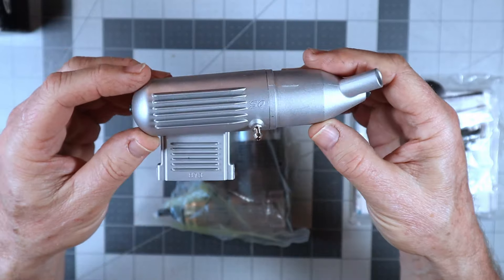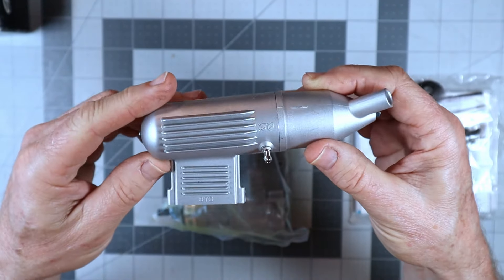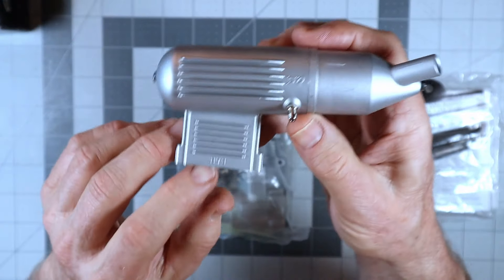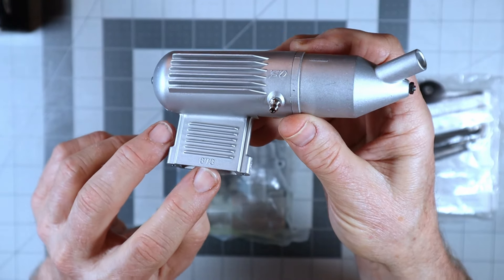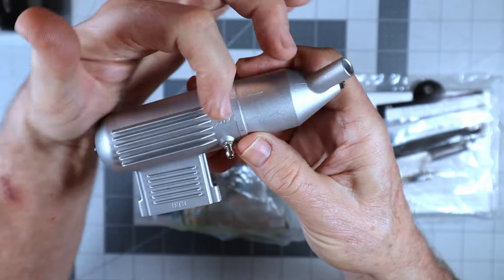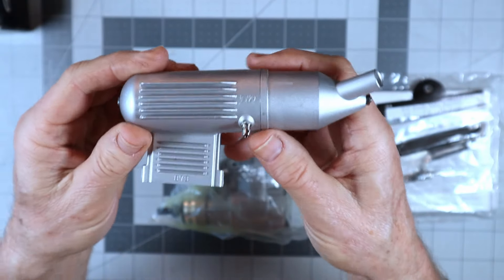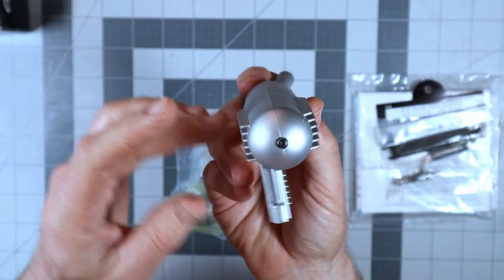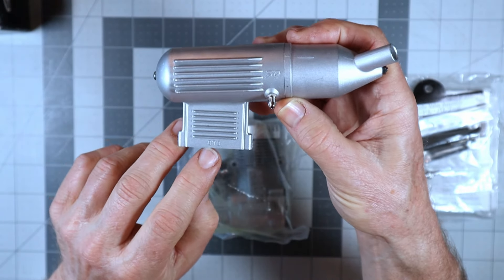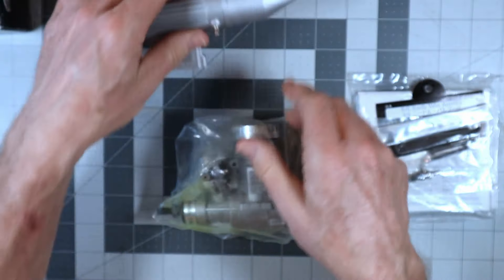Here is our brand new, never seen a drop of fuel, exhaust. This is the 873 exhaust, which was pretty much a standard exhaust for the SF series engines. Those of you who know OS engines very well — they all have a number here, and they'll say OS here. If they don't have OS or a number, it's not an OS exhaust. There'll be a lot of copycat exhausts that look very much like OS exhausts, but if they don't have a three-digit number and OS stamped on them, it's not an OS exhaust. So this is the 873 exhaust.